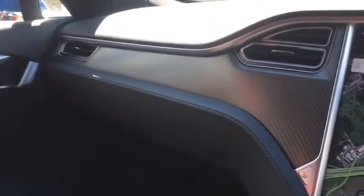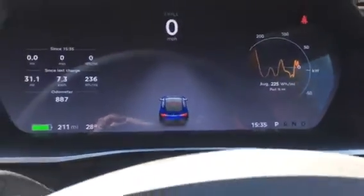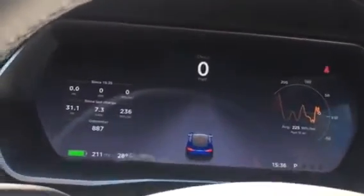After 30 seconds of the alarm sounding it will pause briefly before re-triggering. I'll just let that time out. Now, just to show you — if I turn the driver card on, one of these little cards the driver keeps with them, the alarm disarms, ignition comes on, and we're ready to go. You can see D for drive, back to park again.